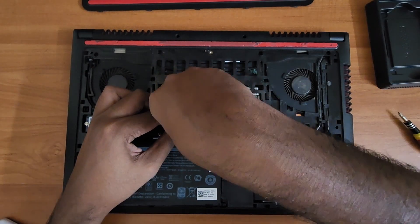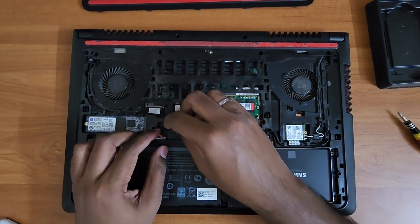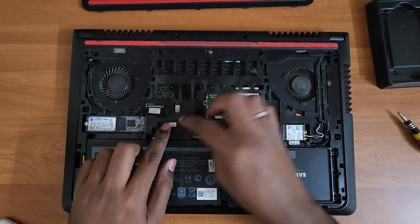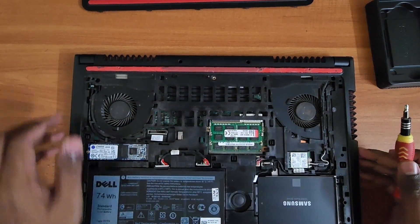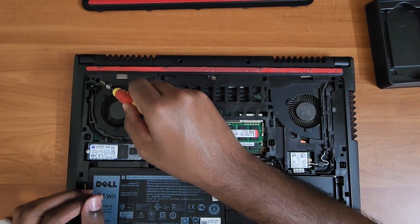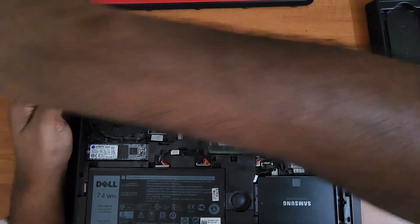You can now connect the laptop battery cable again. If you'd like to see videos on the RAM change or battery change, I'm attaching those links. Once all these parts are changed, your laptop is almost as good as new and you'll definitely notice a significant performance improvement. Also, before I forget — while you're at it, ensure you tighten those two hinge screws. These usually get loose, so whenever you open the back panel, tighten them back. If they are loose, your hinges will break or you'll get a creaking noise.